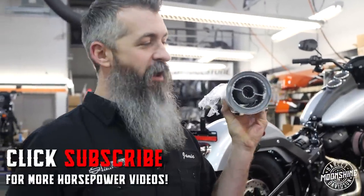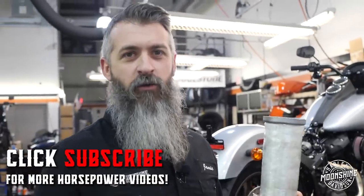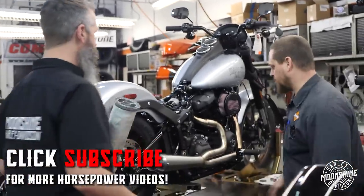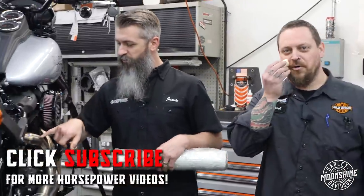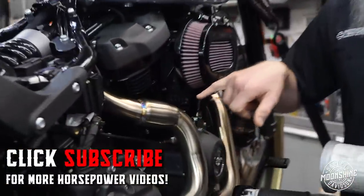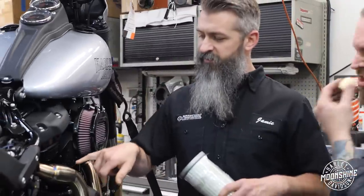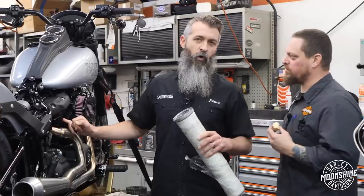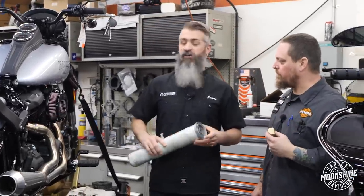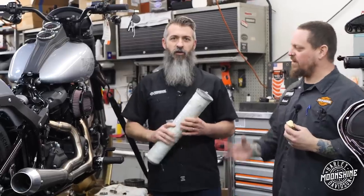They go in the Thrashin pipe, the AR pipe, which actually, should we talk about the AR chamber as well? The anti-reversion chamber is a patent that Feuling has that they have teamed up with Thrashin on their exhaust. So they put the anti-reversion chambers right here on the exhaust. Feuling has a patent for these, and they work with Thrashin to produce these pipes with their design. What this does is stop the backflow of exhaust into the cylinder when you have overlap in the cam, which causes reversion to be sucked back into the cylinder. This stops it from being sucked back in the cylinder while your intake is opening.